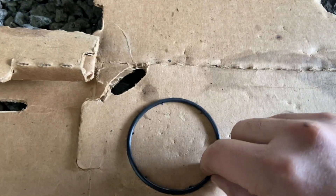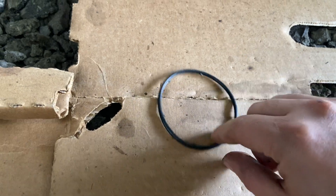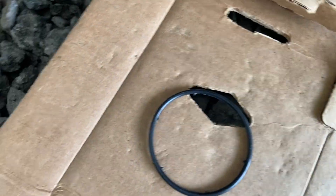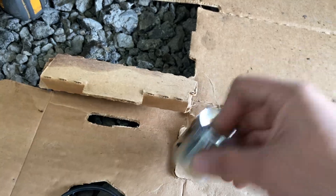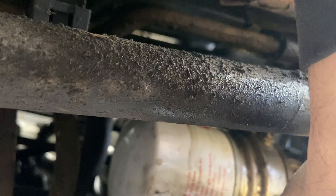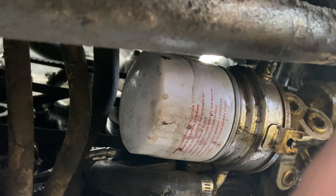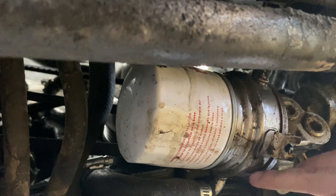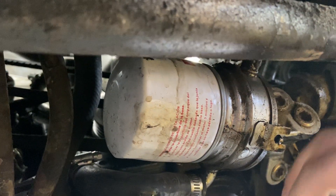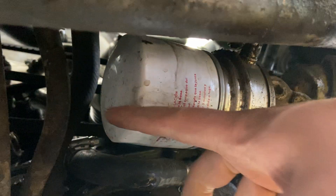I got this in the oil cooler kit from RockAuto — I'll leave a link. There's a kit with about five seals and this o-ring comes in there. You need a 30 millimeter socket and an oil catch can. What you're going to do is remove the oil filter and the bolt — the threaded part where the oil filter threads on is also a bolt that keeps this thing together.